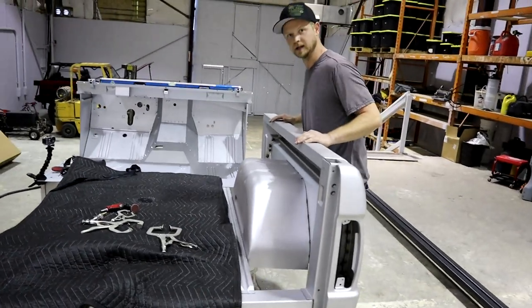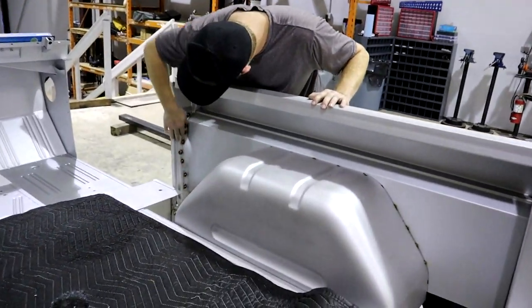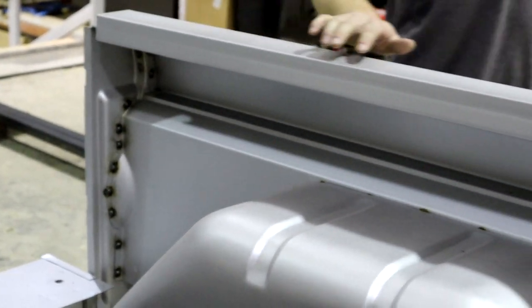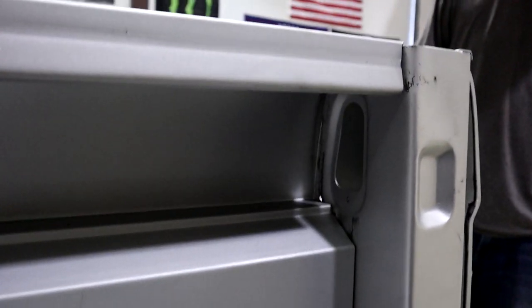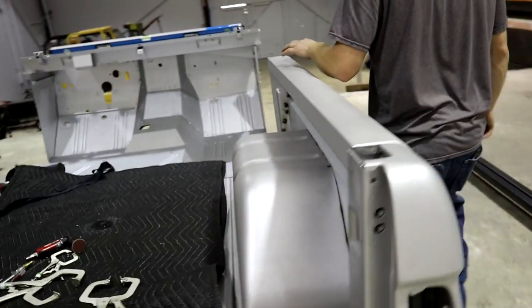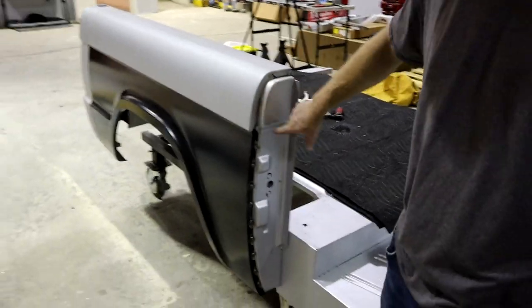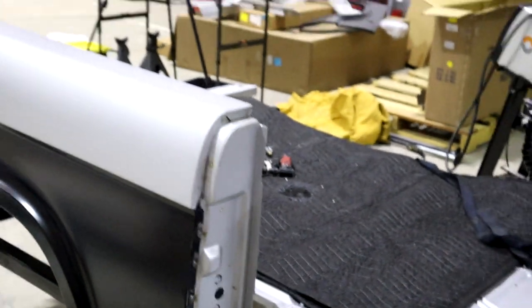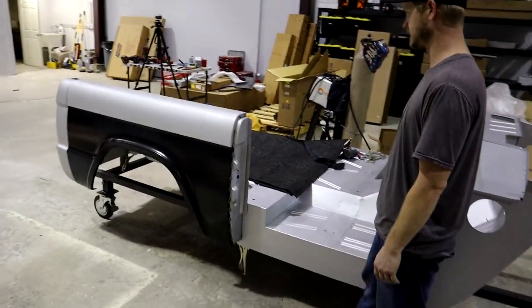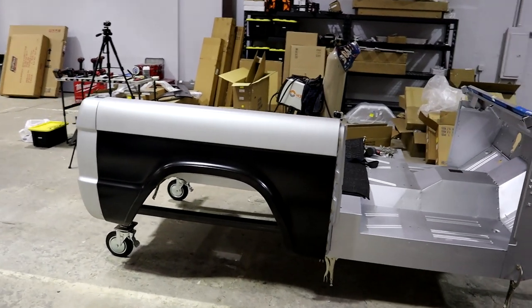We made a little bit of progress — hopefully in the time-lapse you guys will be able to see what we did there. A lot of tweaking. We got all this done; a few spots here where there are some exposed welds, no way of hiding those. But in the rear light bucket here you can see we welded pretty much everything from the inside upside down — not much to be seen, so that's the benefit: no grinding and less body work when it goes off to paint. Over here there is a bit of grinding that needs to be done in some of these areas, as you can tell by some of the heat marks. We did do as many welds as we could on the inside, but the fitment's great. We built that over there, set it in place with three clamps and it sits in place. So we'll get started on the other side and get that one going — probably finish it up tomorrow.